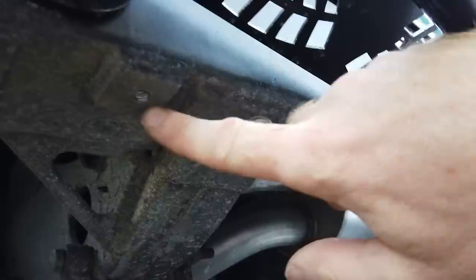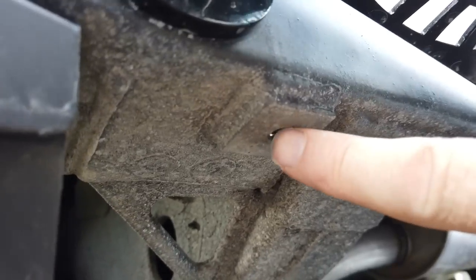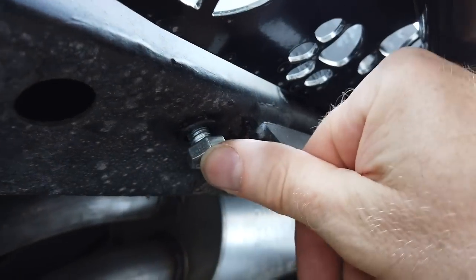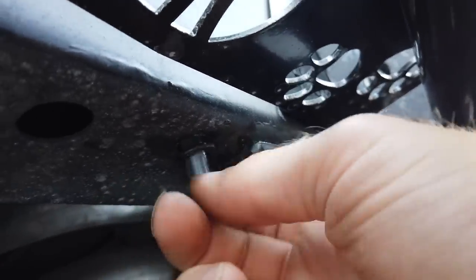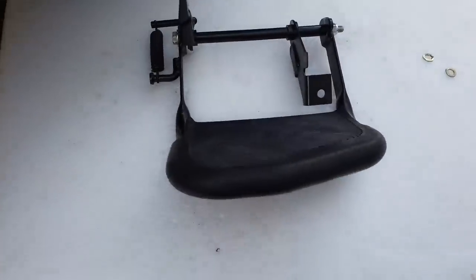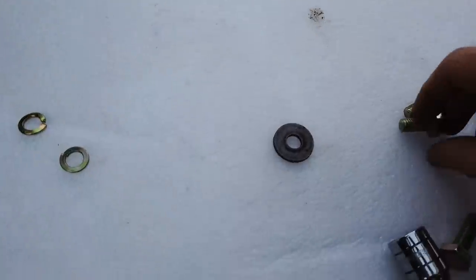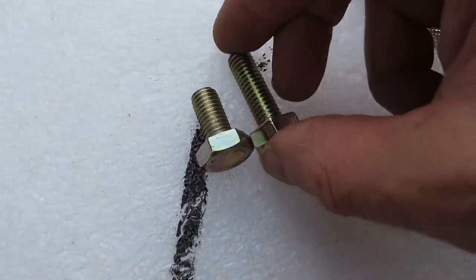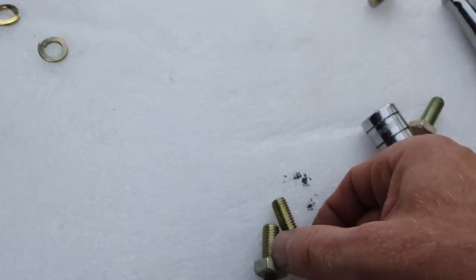There's the original plate with the tapped hole — I did have to clean that out with a tap actually. We've got a galvanized chassis and I think the galvanizing clogged the thread a bit. Gary's fitted the other riv-nut in — it pushes up so hopefully it won't turn. He knocked it in and says it's quite tight. So that's all good. Now the genuine bolts that came with the kit are pretty short, even compared to the riv-nut. The threaded hole in the chassis turned out to be M8, so I've had to put an M8 bolt there — you'll really have to check what size things are on your Defender. I've gone for longer M10 bolts and I've got a couple of spacer washers that I'll need to get them up to the same level.